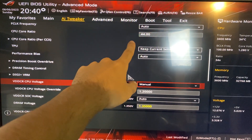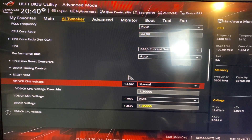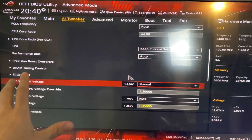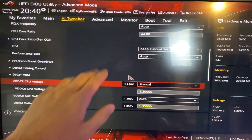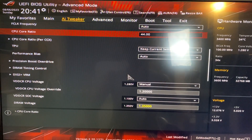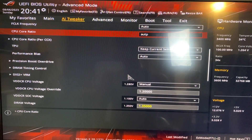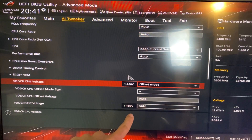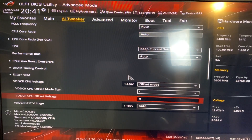In case you don't want to reduce the core clock, we can also do a dynamic preset. With this you get more performance in productivity and overall better performance in games, but you might get lower average FPS. So if you want the absolute maximum performance just for gaming, it's better to leave the core ratio on auto. Then on the CPU voltage, don't put manual — put offset, select a negative sign, and enter 0.05.